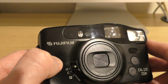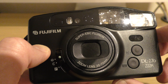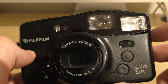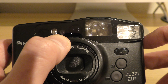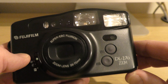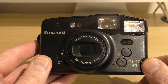Looking at the top of the camera, working our way across — there are two little black circles, which are the autofocus windows. I had to look in the manual for that. Then there's a little lamp on the left-hand side for red-eye reduction. Right next to that is the automatic exposure light sensor. Then you have your viewfinder and your flash.